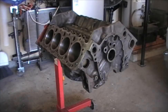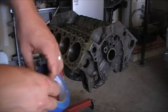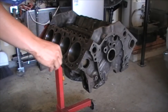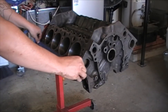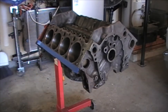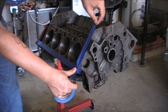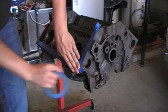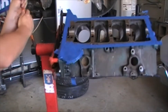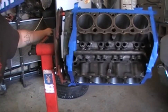Once you've got that done, you can take some masking tape. I like to go to Walmart and get the decent stuff — the dollar store stuff doesn't seem to want to stick all the time. When masking off these areas, I always line everything out first and then add paper in between so I don't use a whole bunch of tape and run out. I do lines to sort of line out the areas that I want to paint. Once you have everything completely lined out and everything outside the area is taped, you can remove all the excess tape you don't need.